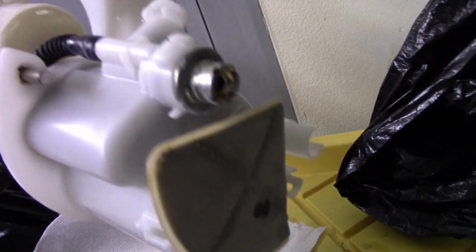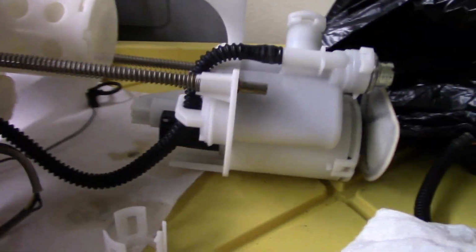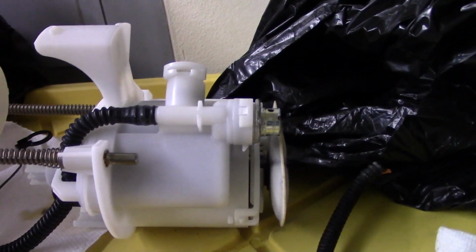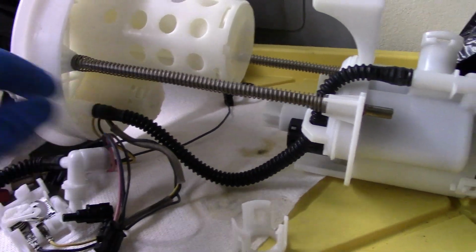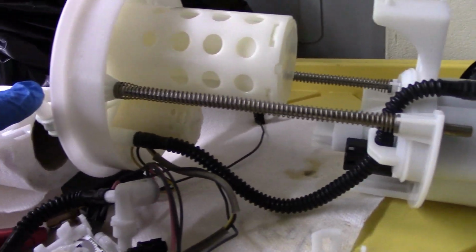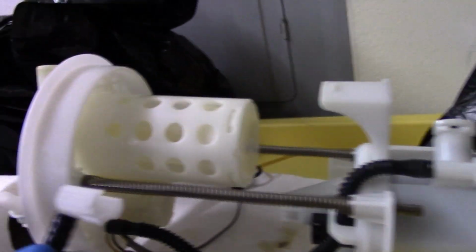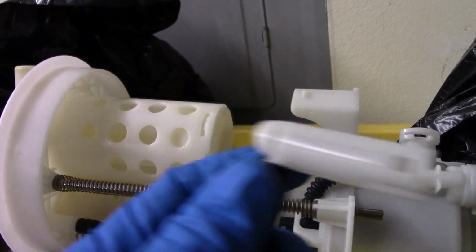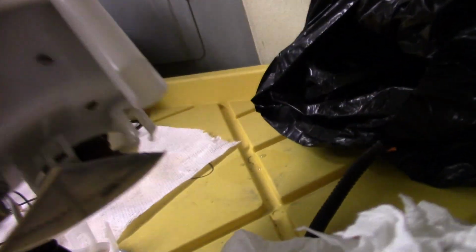So, see, there's a filter on the bottom of this. Now it's finally dripping with gas. So this is basically going to be like the RSX. So this right here, I'm going to put the other hose on it. I'll show you next. But right here, this is going to be your return, and the return is going to bypass everything. So the return is going to connect to here with the hose and onto here. There's nothing in between. It just goes direct. Bam, it connects right.